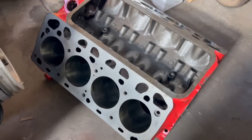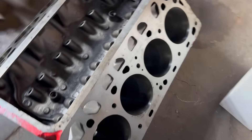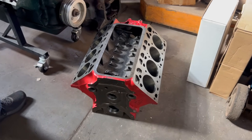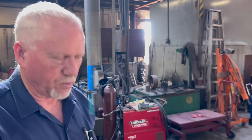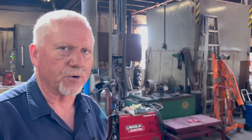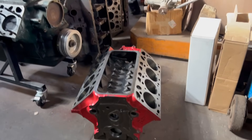You already had the cam bearings in it. Other than doing a cleanup on it, it's pretty much ready to go together. Another thing I do to all blocks when I'm honing them is I have a little ball hone that I run down the lifter bores. When you are putting these things together, it is very important that each lifter is free and easy in its bore — no burrs, they have to spin. I've heard of guys saying 'that's a little tight but it'll loosen up as they run.' No, you just ruined your camshaft. I deburr them, and if somebody nicked it, I'll run a half-inch reamer down in there to make sure it's clear — casting flash too, just in case.